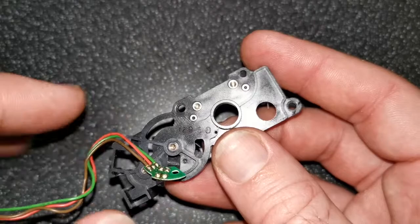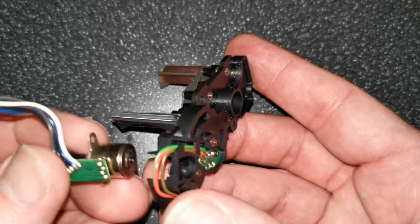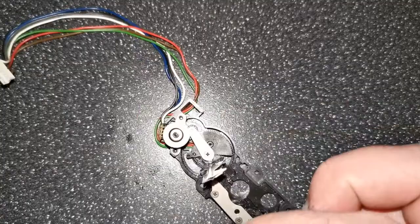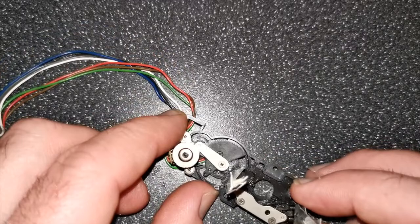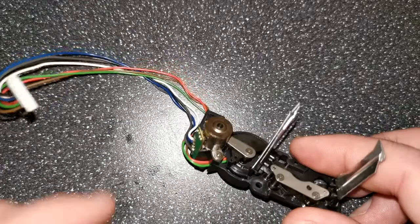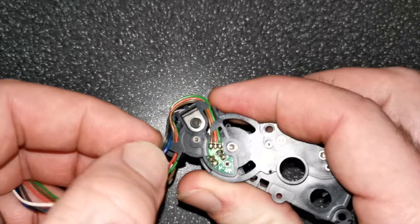First install the optical sensor, route the wires through here, grab the other end of that wire, install the motor with the gear obviously down, and just make sure your PCB clips in. We've got really good movement — you can feel a bit more resistance with the motor in place but you can see how it is fully working. Route these wires back in, and now I'm going to test this in-situ before putting it all back together to make sure it actually works.